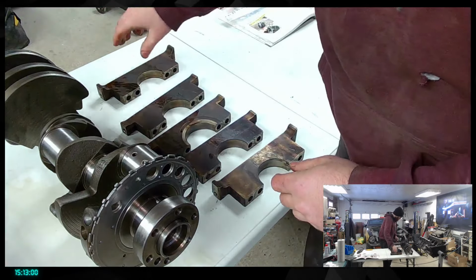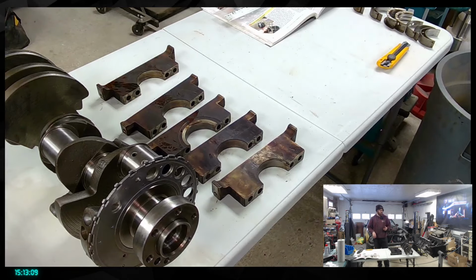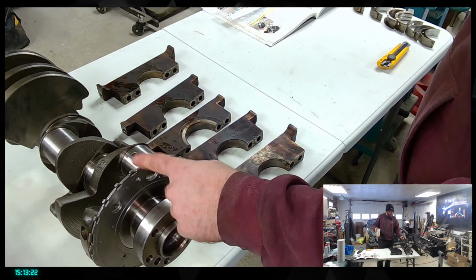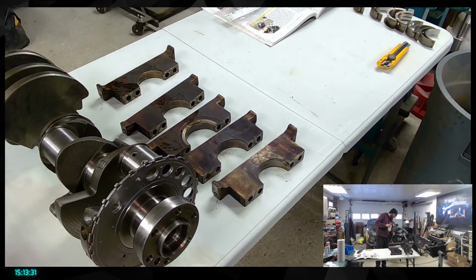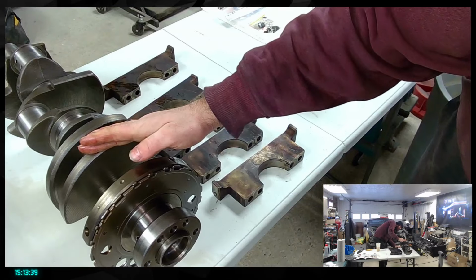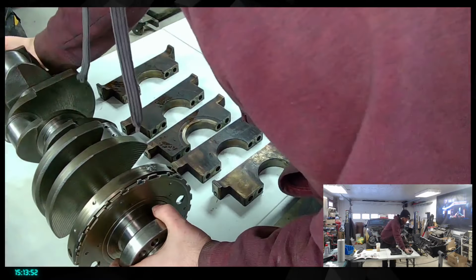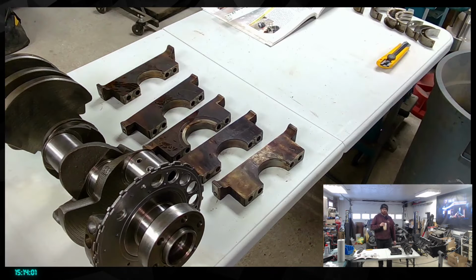At some point, we are even going to measure any bad thing happening with that wheel. So we're gonna make sure it's sitting flat and we are not having some wobbling that could affect the signal sent by this, because all the little tabs here are sending to a position sensor, so it's clicking every time it's going through one of the teeth. And after that, the computer knows where it is at. There's probably an empty spot usually that is used to measure that. I don't see it actually. It should have a missing tooth at one place. Oh, maybe not on those ones, but basically they are using that to have a position reference, and therefore it's used to send a signal for the spark plug and stuff like that.